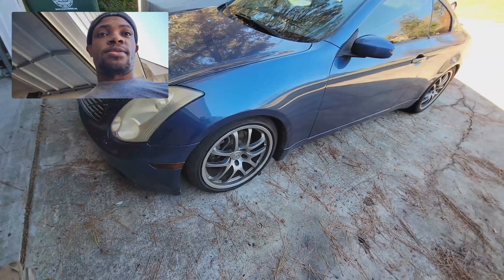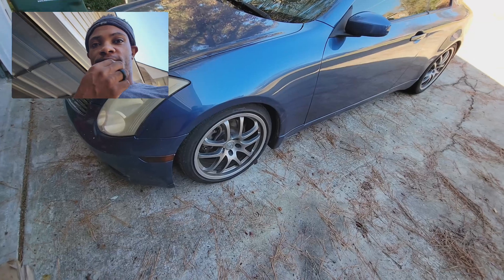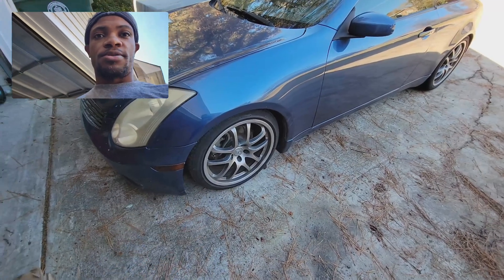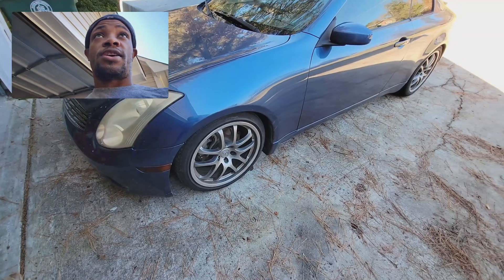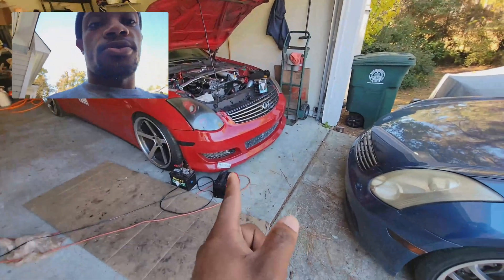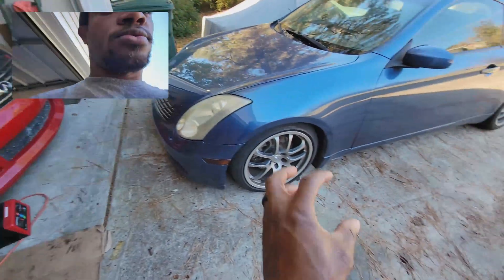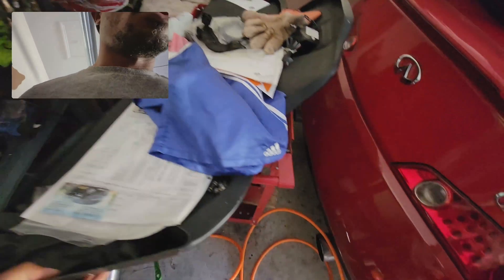So anytime, depending on which way I tightened on it, tightened on the ball joint and stuff. Also, the note — 05 through 07 coupes and 03 to 04 coupes, if you know anything about the G's, they have these little cones in them for the suspension. Thought that was the issue, changed it and it did get better.